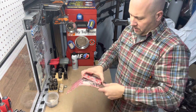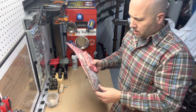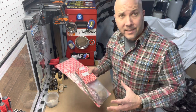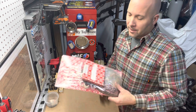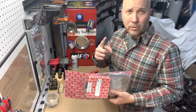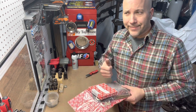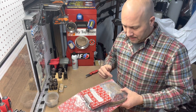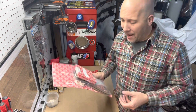Let's see what else we have. We've got the engine gasket with rear main seal, and then the whole gasket kit — so this will allow us to basically get all the gaskets where they need to be. You can piecemeal it, but a gasket kit will save you. In all honesty, just keep one handy — and if you're going to order them, order two. I only ordered one this time, but I've gone back and ordered another one, because either you're going to tear one, lose one, or a gasket will fail and you'll want a spare. They're not that expensive.